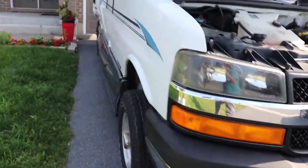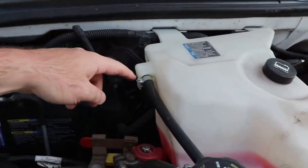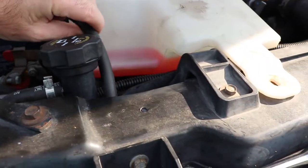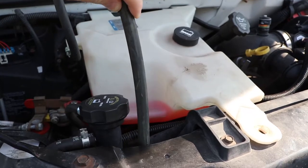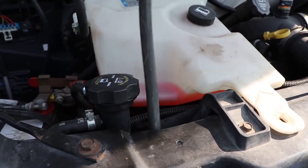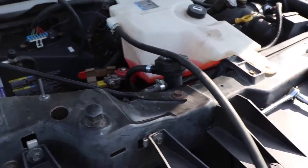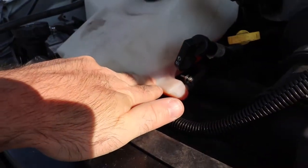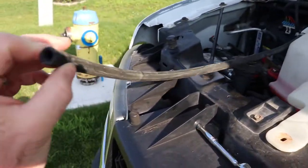So on this vehicle, when you back into the driveway and go over this bump, it jostles the tank and the coolant flows up and out the overflow. Basically, it pours down the front of your radiator and onto your lower rad hose, making it look like you've got some kind of coolant leak. You're constantly trying to maintain the coolant level, but you're not leaking anything per se — it's just running out the overflow.